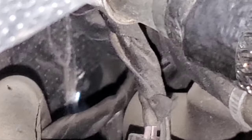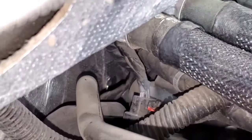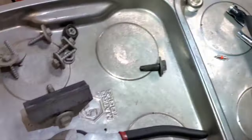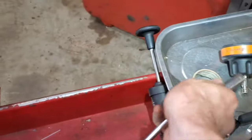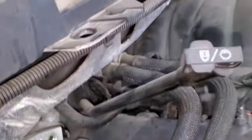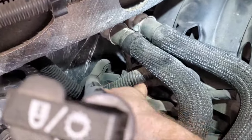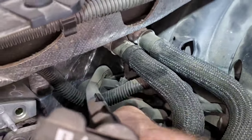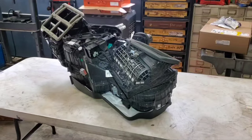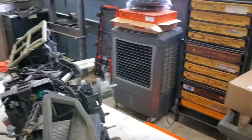You can see it right back there — I've already pulled it out. In order to get to that bolt you use a really long quarter-inch extension with an impact swivel, quarter-inch into a 10-millimeter, so we have a double swivel. You're going to place the extension right above the valve cover, behind the connector for the rear coil, going way back at an angle. The HVAC box pulls out with no hardware on the inside — it's only bolted on the firewall side.